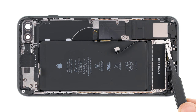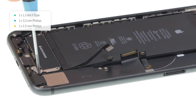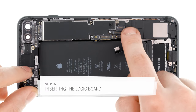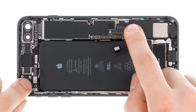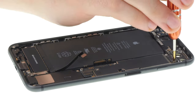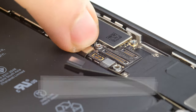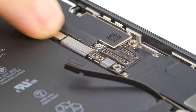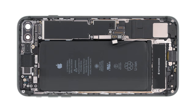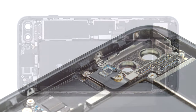Don't forget to screw in the bracket for the connector. Put the logic board back in its place. The small plastic holder has to be on top of the board. Reinstall the logic board using the various screws. Put the three connectors back on their sockets and press them down gently with your fingers so they click into place. Don't press harder if it doesn't work — instead lift up the connector and try again. Now insert the SIM tray. If it jams, check again if the logic board is properly seated. Next, put the wifi antenna back in. Press down the antenna a bit to make it stick and then plug it in. Then fasten the antenna screw.